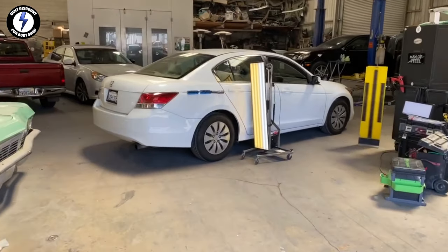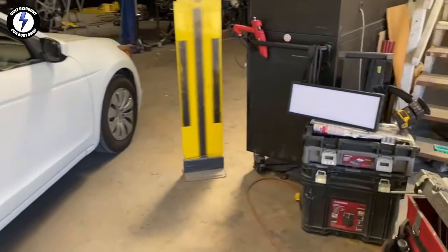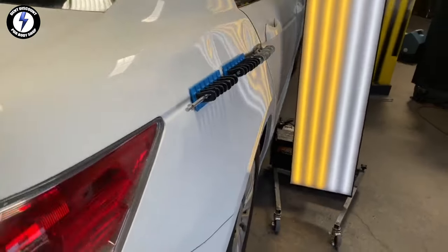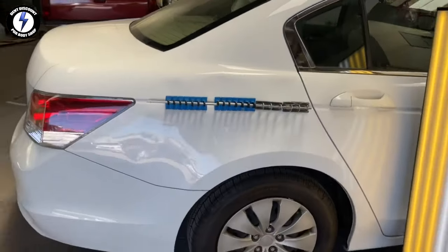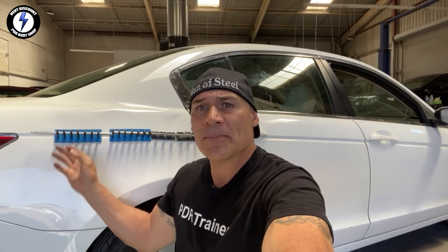It's getting warm outside, so I'm going to do the remaining body work inside the shop. It's time to chime back in on this big dent repair. Are you learning a lot so far? If you're a new subscriber, put that in the comments and I will personally respond. Looking at the damage, you can see I've pulled a good 85% out. My next step is to remove the pins and the glue tabs so I can take a closer look at the body line. I'm cleaning the panel with alcohol.